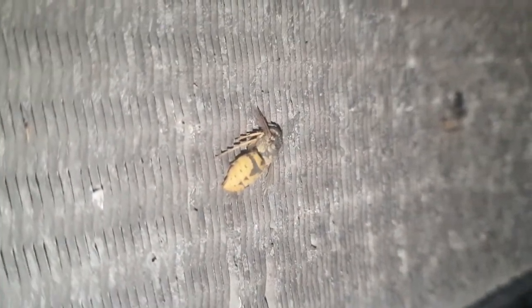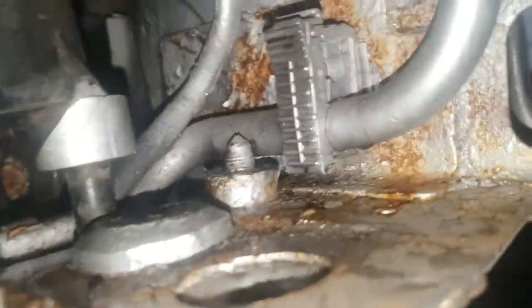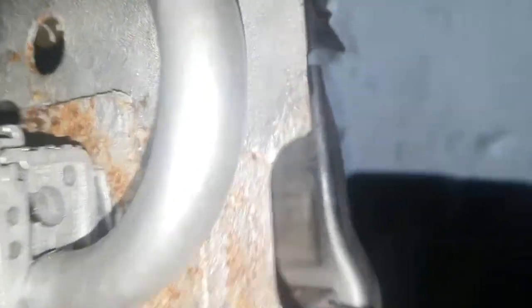I've got one more thing I need to take off, and that should be it. I think that is the gearbox cooler that I need to take off, and then this radiator is out of here. This is the botch job we attempted a while ago - this is what I've got a chisel for over there. This radiator is going to come out. I might keep that fan on there depending on which one's in better condition. And this hose here should come out - it just needs to unclip from there. It is a power steering line anyway. Let's get this radiator out.